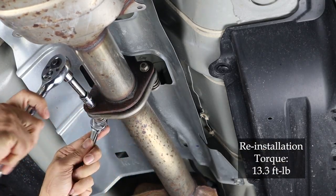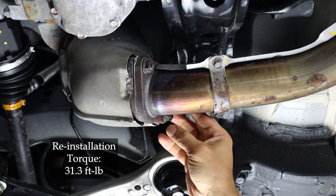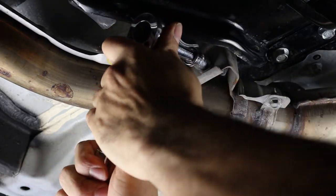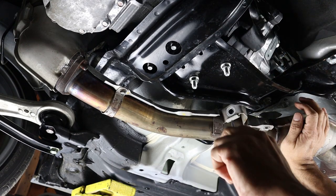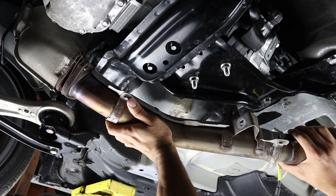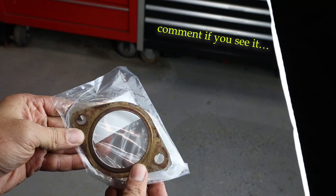For the rear, just grab two 12 millimeter wrenches and remove the two bolts and set them aside. Then move to the front where you'll find two 14 millimeter nuts. My car is new so this doesn't give me much trouble, but if your car is older, exhaust parts can be a real pain to remove, so make sure you have a breaker bar handy in case your regular wrenches won't do. Once those two are out, use that same 14 millimeter wrench on this bolt attaching the mid pipe to the bracket. Don't forget to move the oxygen sensor cable down so it doesn't get caught on anything. Take the mid pipe and remove it from the bracket — you might be able to do this by hand, but it's easy to pry with a flathead screwdriver. Then slide the mid pipe back and out. This gasket is very cheap and should be replaced when the mid pipe is reinstalled, so make sure you have one available before you start.